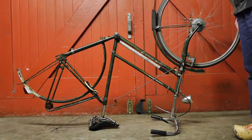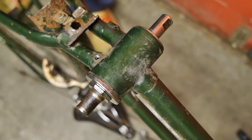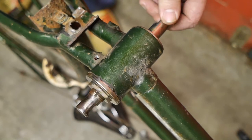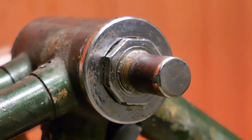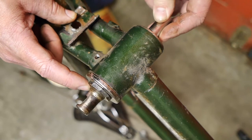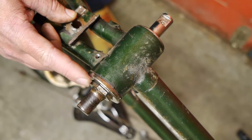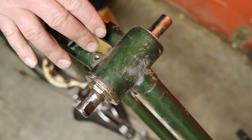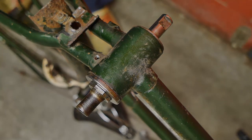Now I need to reinstall the wheel into my uncle's old Gazelle bicycle, but first I need to reinstall this cloth chain guard onto my Union bicycle, because at the moment I'm using that Gazelle bicycle almost daily. I guess that reinstallation is going to be a very long video. To be continued — I will continue scrapping this bicycle. One quick question now that I have your attention: how do I take apart this bottom bracket? I never saw this model before — the whole outer part is turning with the axle. There's a locking nut and some thread, so I assume that's where I start, but how do I grab it? I guess I could chop it up with the angle grinder, but any better ideas?